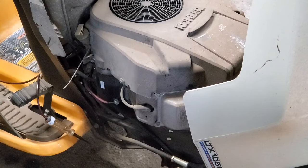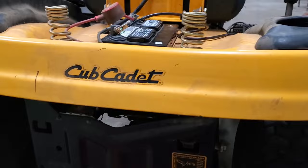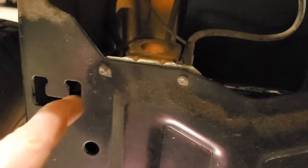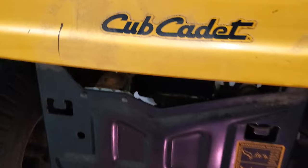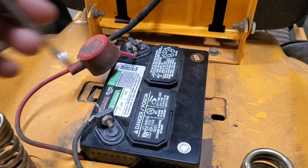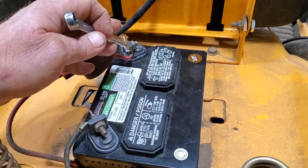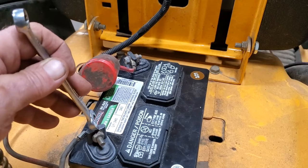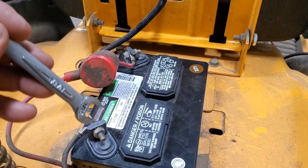Well of course these geniuses, like quite a few mowers, look where they put the solenoid — it's under the back. So you've got to put your socket in up here to get the thing loose. What we're going to do is I'm going to remove this battery and then we'll be able to get in here and test this. I see it happen a lot — people will want to take their positive off first. That is wrong because your wrench can come down and short. Take your negative terminal off first. When you put a battery back in, hook up the positive first and your negative last.